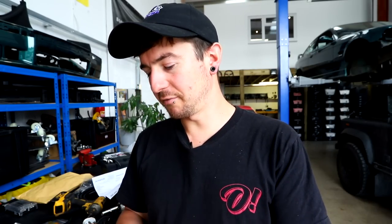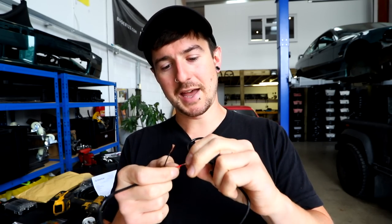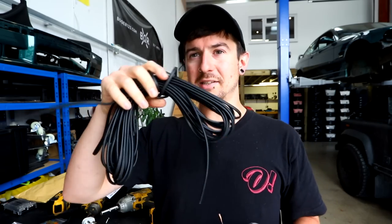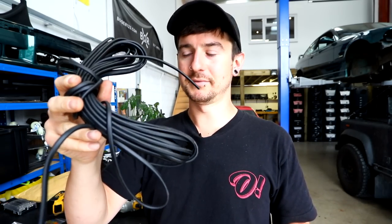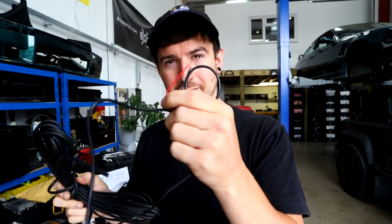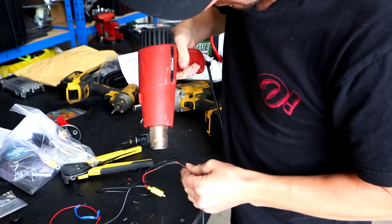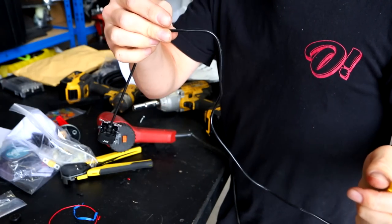But I kind of want to be able to access the camera at other times as well — like if I'm towing, or if I've got stuff strapped to the back and I just want to see what's going on. So I'm going to find a different source to tap into. I basically just need any 12-volt power source that is on when you turn the key on, so it's like accessory power. With the kit you just get loads of cable, so I'm going to strip this back, connect those two up, find a source for my 12 volt, and put this back in the truck.